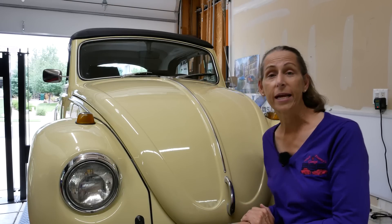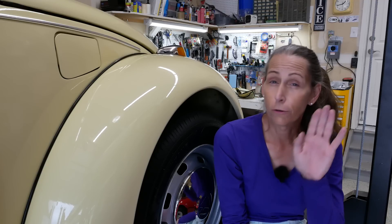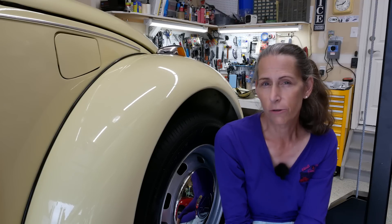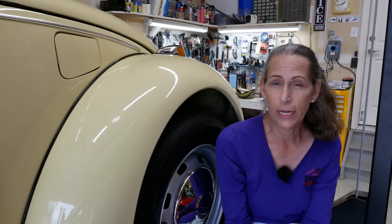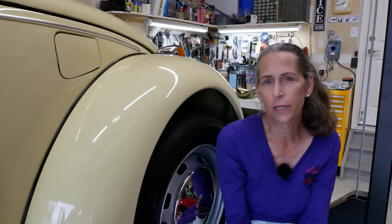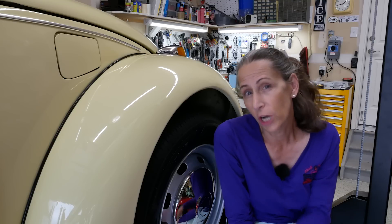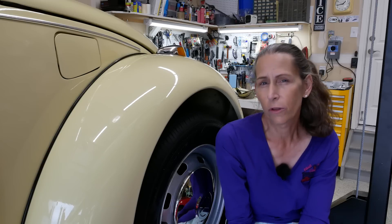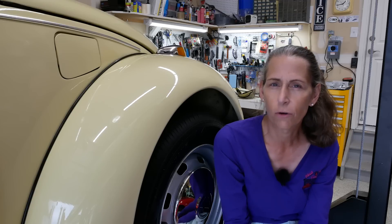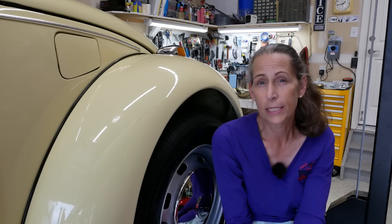I think I'm going to start with the brakes — it's kind of the most important bit. The owner was telling me that the brake pedal goes almost all the way to the floor before it really starts to engage. I took the car out and drove it and he's absolutely right. It doesn't feel solid, just mushy. So we'll adjust the brakes first, then bleed the system to see if there's air in there, and go from there.